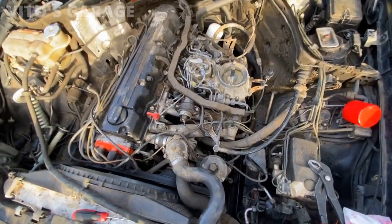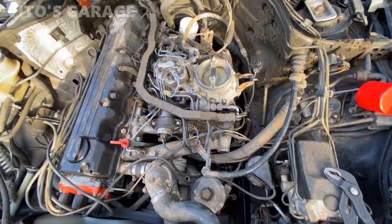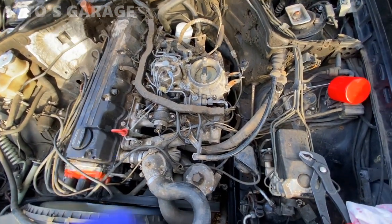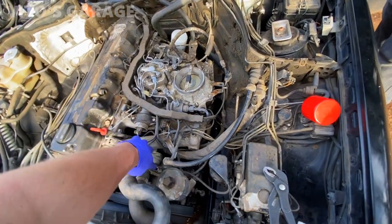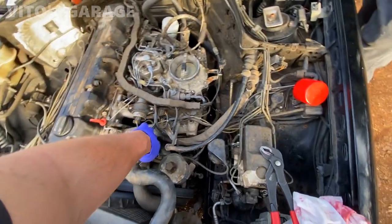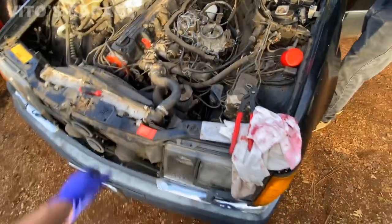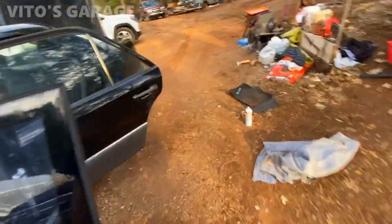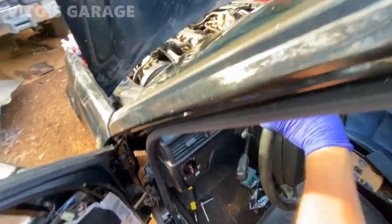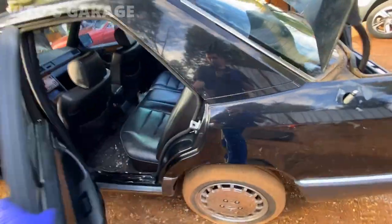She's good. You're also going to need a belt for it. The belt is pretty cracked up. Yeah, I figured it could be a new one. Is there a tensioner on it? Yeah, it's got a tensioner, which is this guy, but before you turn this nut, you have to loosen a 19 millimeter bolt on the tensioner assembly. Okay. Before you touch this guy. Yeah, because you're going to break the tensioner. Ah, that's good to know. Perfect. And then I'll look into the wiring some more for the headlights and stuff like that. Yeah, because that would be holding me back greatly. And we'll do the brake flush next time, too. Sure.